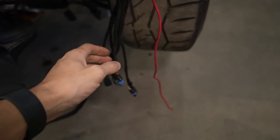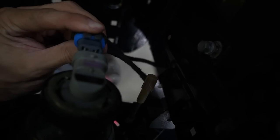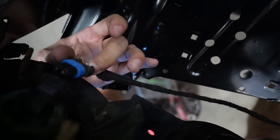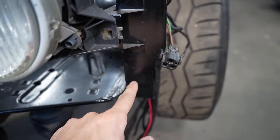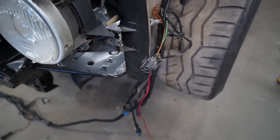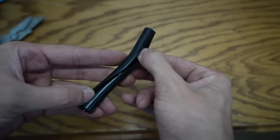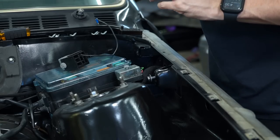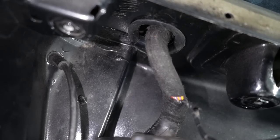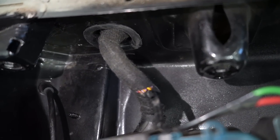For this first headlight the wire is just barely too short — the wire comes around right there and goes around this little piece of sheet metal. The low beam one will fit, it's a little bit stretched, but the high beam is also very stretched so they need just a little bit of slack. I'm going to drill a hole through right here so that just these two wires could go through there so that I don't have to splice anything. I want to see how smoothly using a little bit of vacuum line around this hole goes — I stuck it in there and wrapped it around. I had to make another little piece of grommet because the one I cut out wasn't long enough.